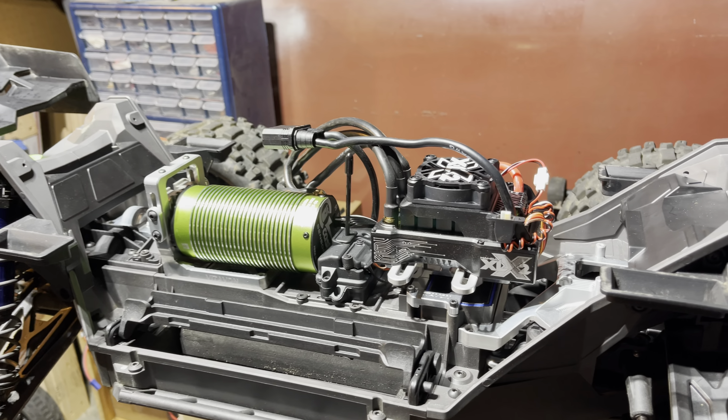That's going to do it for this part of the overview. The install didn't really have any issues — it was all plug and play, bolt on and go. The only thing is with the motor mount, you have to attach it to the motor with everything outside of the truck first, because you can't slide the motor in once the motor mount itself is locked into the truck. So you need to attach the motor to the motor plate and motor mount outside of the truck, then throw it on and set your pinion.